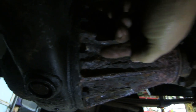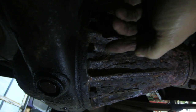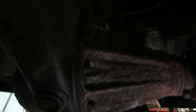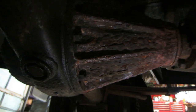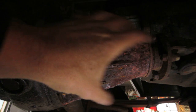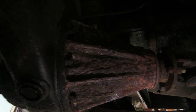The pinion is the piece that goes through — there's a gear on the end of it that runs into a ring gear, the driveshaft spins and makes this section go around. I don't know if it took out the pinion shaft up here — I'm not worried about the bearing itself but I'm worried about damage to the shaft, damage to the housing, and whether the ring and pinion got damaged on those surfaces. We won't know until we pull it apart. We'll get the driveshaft off, back off the wheel, slide the axles out, and this whole assembly will come out.